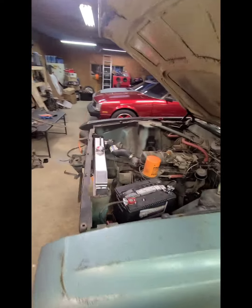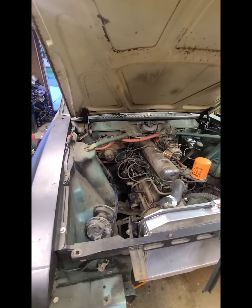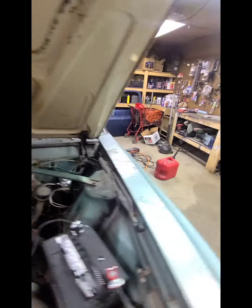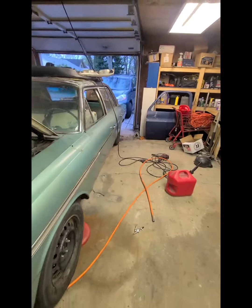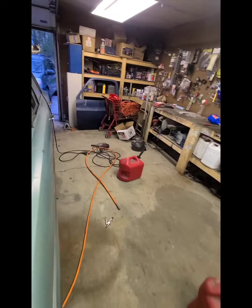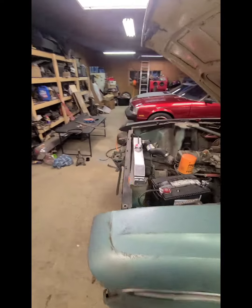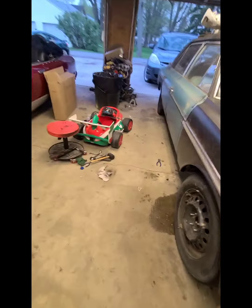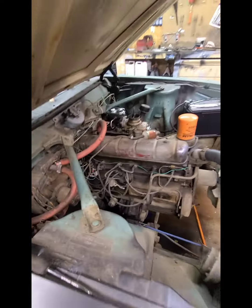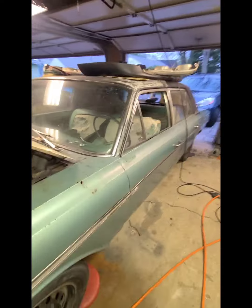All right, so all I ended up doing was I pulled the hose off down here. I blew back through it to make sure that there was no clog in the line. Not only did I hear gas gurgling back there, but it even shot some out of the neck. So, therefore, I know there's no clog. So I left the line unhooked here, blocked off a majority of the neck with the towel, put a little bit of compressed air through the tank, primed the system, got it to start flowing a nice little stream of gas up here, and hurried up and connected the line back up. So the system's now at least primed for the minute, and I have gas everywhere.